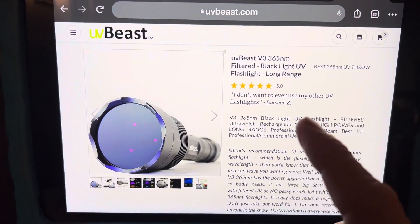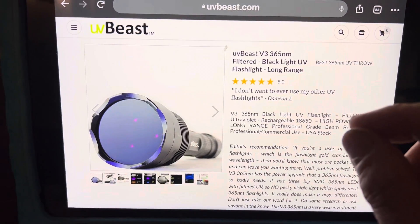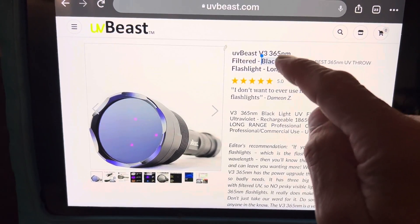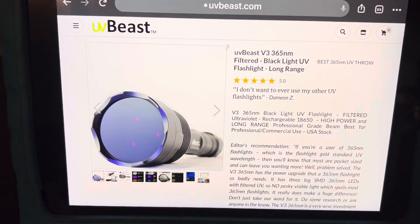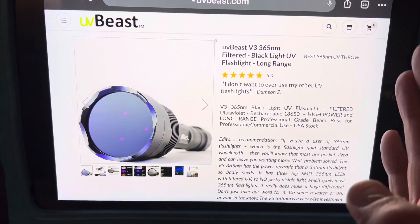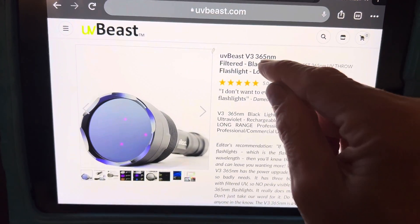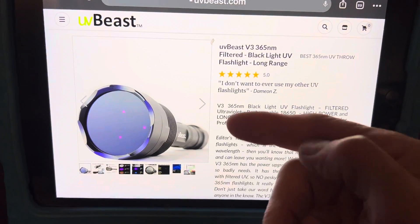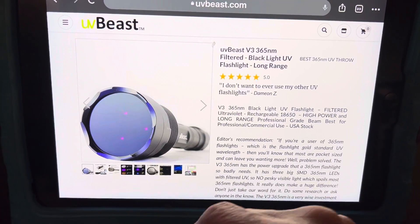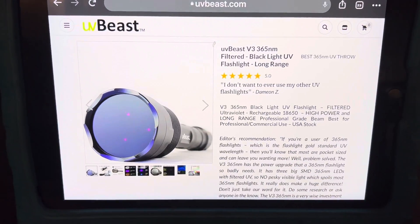I'll just go over this really lightly. Different fluorescent manufacturers make their dye at a different nanometer wavelength. This one is 365, which is the most common one. Every light bleeds off a little bit higher and a little bit lower, but it's more centered around the 365 UV dyes. So like your Tracer Line products or AC Extreme are two dyes that I use, and this is really highly geared toward that.